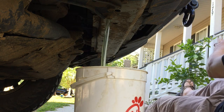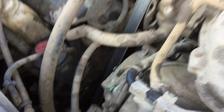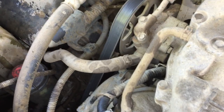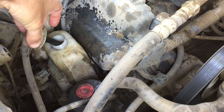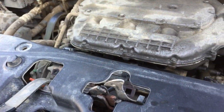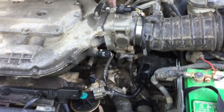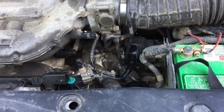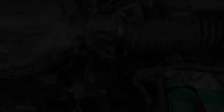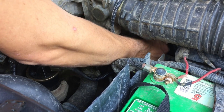I'm going to undo the cap on the top. The fluid looks fine. When I undid the cap, it did something I'd never seen before — it somehow forced some pressure to get released, and my fluid reservoir is overfilled at the moment, which I think was from the fluid getting hot during overheating. But it does seem a little odd that there was that much pressure left in the system. Either way, replacing the thermostat is a good step in the right direction. The one I bought was only about $28 after tax, so we'll replace it and give it some test drives to see if that resolves the issue. There are a lot of sensors and wires going into this housing, so I'm curious to see how much room I have when I undo it.